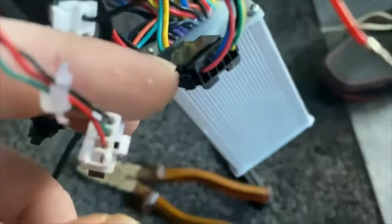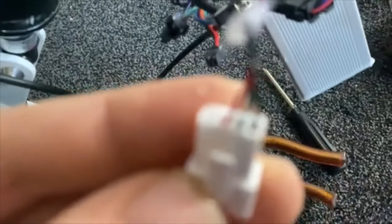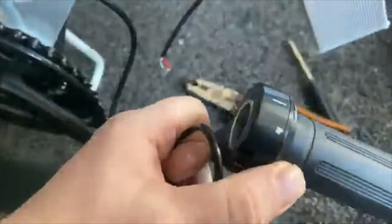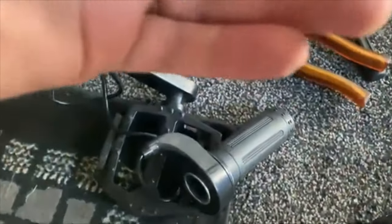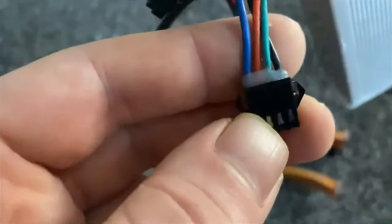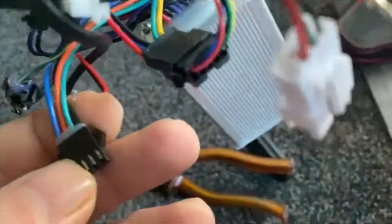You normally have a red wire — I've just pulled that red wire out, which is just there. That red wire sits in this bit here at the back. Now on this wire, the reason I'm showing this is because the colors are different. We've got black, we've got green, and we've got red. Now when you buy a twist throttle like this — I prefer it over the thumb throttle — it turns up with white, red, and black.